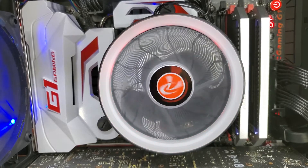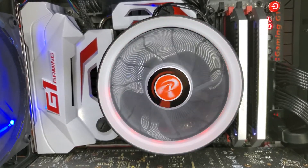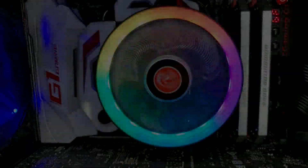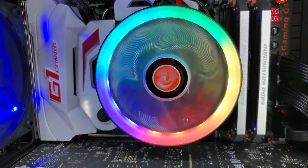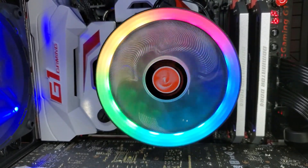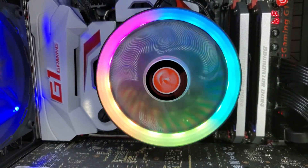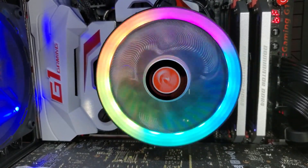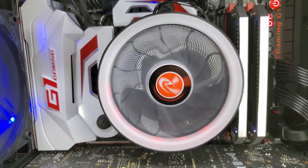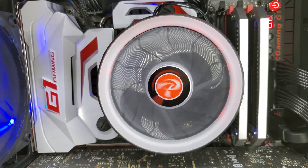One more thing: when I was swapping over to the 6700 non-K, I noticed discoloration from the thermal grease that came with this CPU cooler. I do not recommend the included thermal paste — it appears to be oxidizing with the metal and was discolored on the CPUs. Overall, this is a decent CPU cooler, but pay attention during install regarding the RAM slot and the bracket fit. One thing is definitely sure: it's not built for a 105W TDP — it's built for 65W.